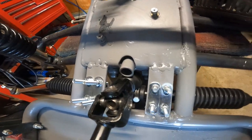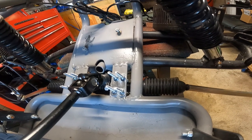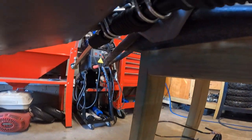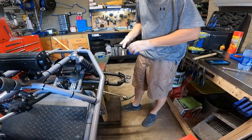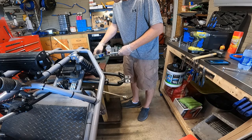Now I'm sure there were probably better ways to do this, but this is for people that have one and have been wanting to do rack and pinion and want to do it with the basics. You can see the spacer out of the tubing that I made to go in between the plate that I welded in and the rack and pinion — that way it doesn't put any unwanted pressure on the rack and pinion over time and cause it not to work properly.